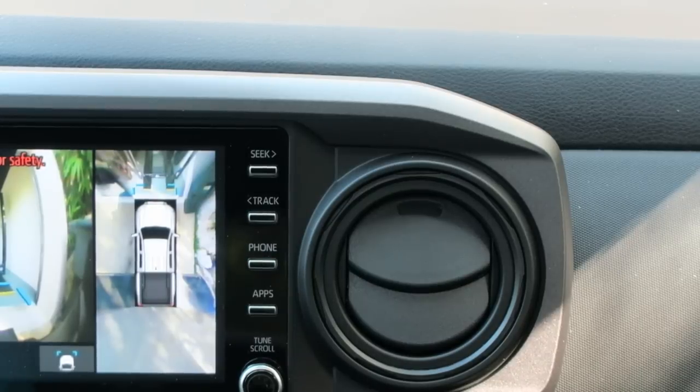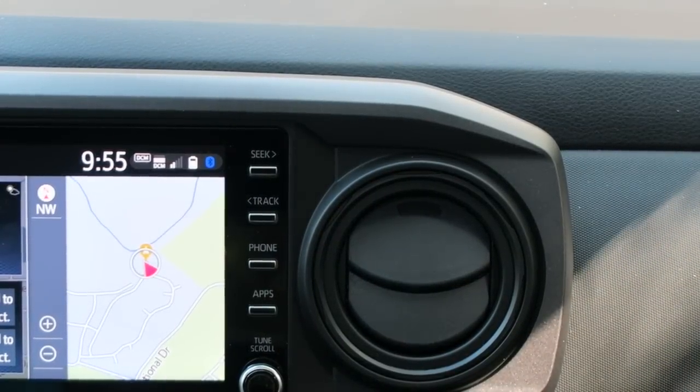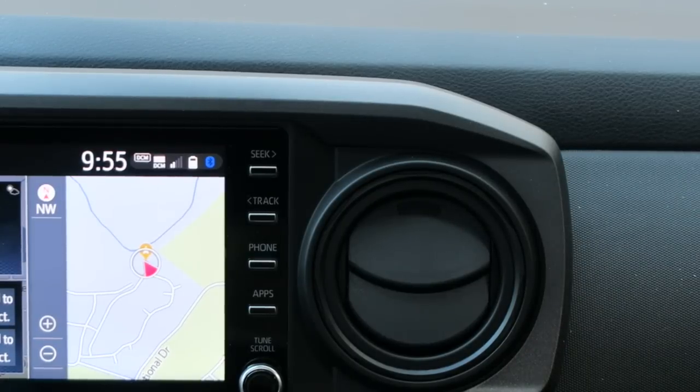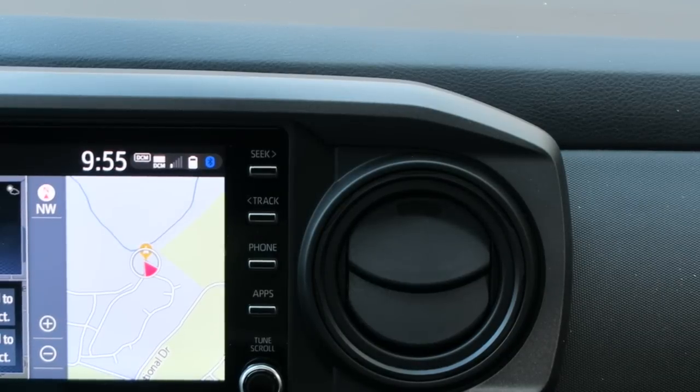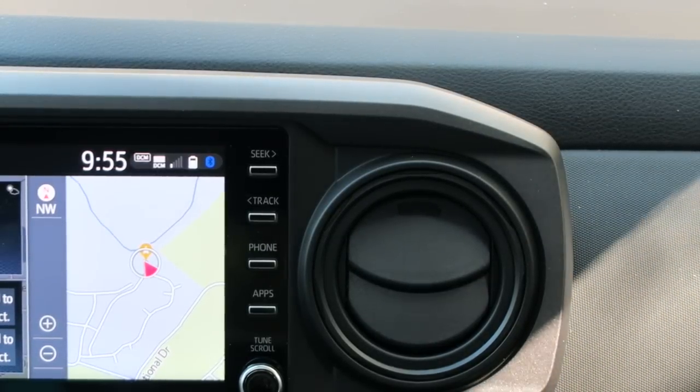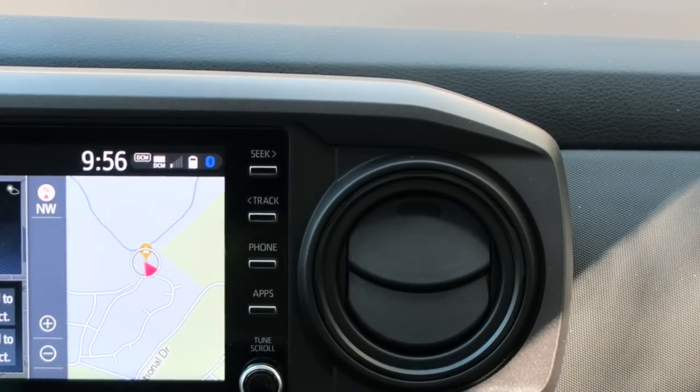Here are the instructions. Start the truck and let the screen fully load to the home screen — there is the home screen, the truck is already running. Then locate the headlight switch, which is right over on the stalk, and the audio button on the head unit. Hold the audio button while flipping the headlight stalk between auto and on — the middle two options — three times. Then it loads a menu with multiple options, and he believes one is the camera settings where you go into a menu of colors, choose the color you want, and hit okay. To get out, just turn the truck off and restart. So we're going to hold the audio button and flip this switch back and forth three times. Wish me luck!